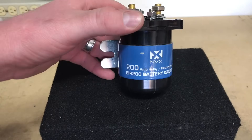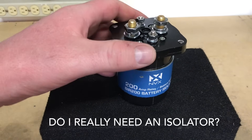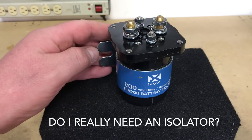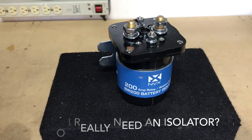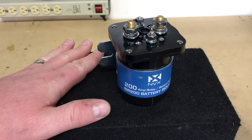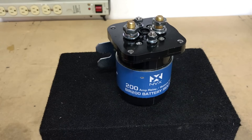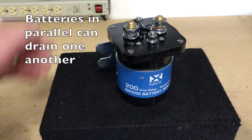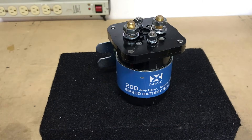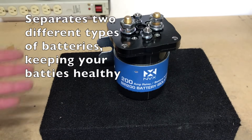A lot of you may be asking: do I need one of these on my car? Generally speaking, battery isolators isolate just that — they separate two batteries or multiple batteries in your vehicle depending on the application. For example, this would isolate the primary battery and secondary battery bank in the trunk while the car is off. That's popular for those who like to listen to music with the car off, protecting your primary battery so you don't drain or ruin it with overuse.